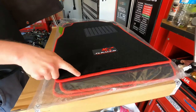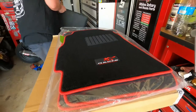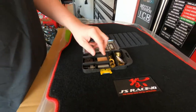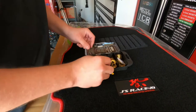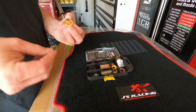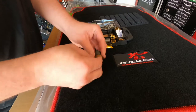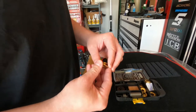The Jay's Racing mats have no grommet, so we're going to put a hole in these brand new three-hundred-dollar mats. We have a grommet kit - it comes with a punch to knock out the appropriately sized hole in half-inch and three-eighths sizes. Once you punch your hole, you put the grommet over it, insert the punch tool, and hammer it to fold the lip over, creating a tight seal.